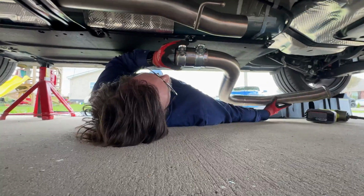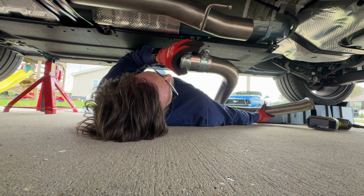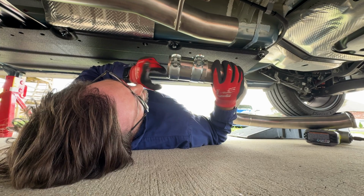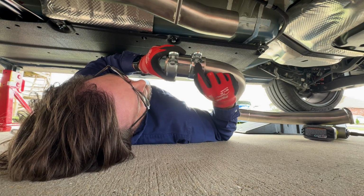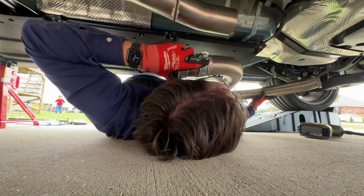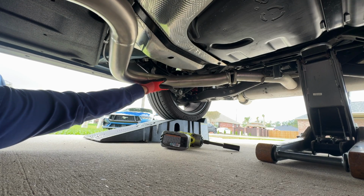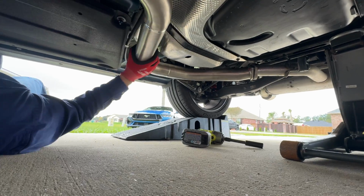All right, so I've got the midsection here. I've already got the clamp slid on this part, and I slid it on this one because you can't get it all the way on this one because of the bend that happens right here. Whereas this one's got a much longer straight section. So I've got it slid all the way on until the titanium lip is showing here so that I know for sure I can get past the edge of the pipe. And also oriented it so that the clamps are facing down where I can easily get to them in the middle of the car. So, like I said, make sure your gasket is still on. And it is. And I'm going to not manage to get this in the hole. There we go. And then slip it in like this.